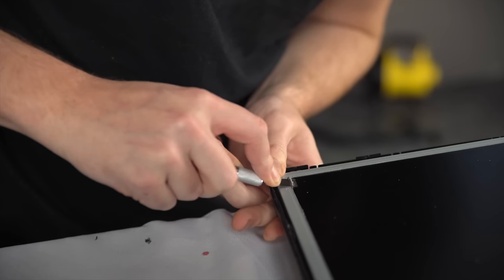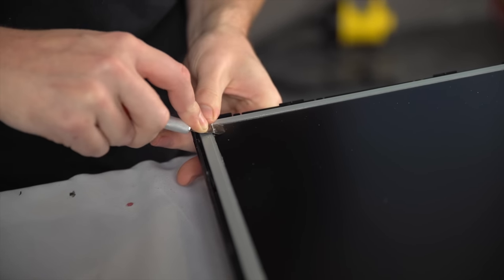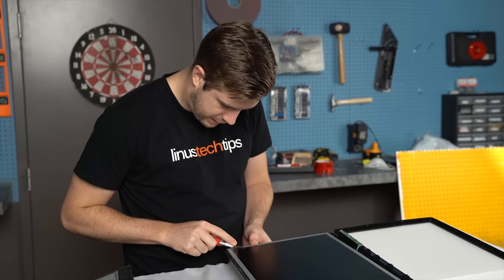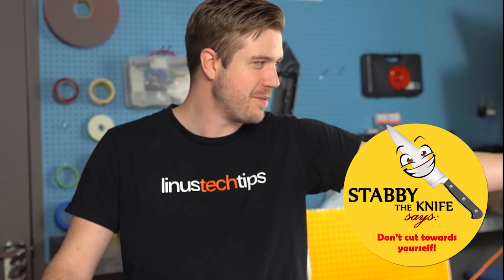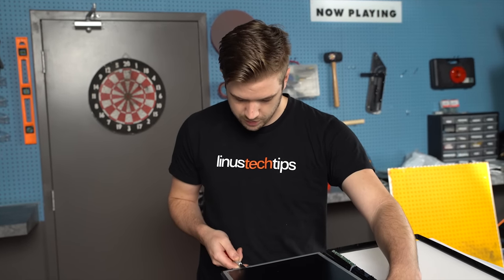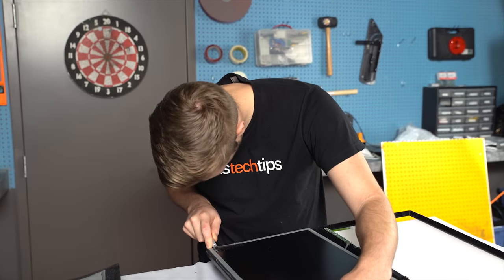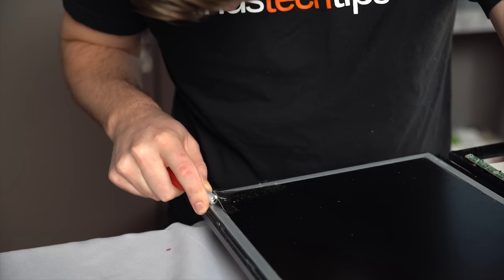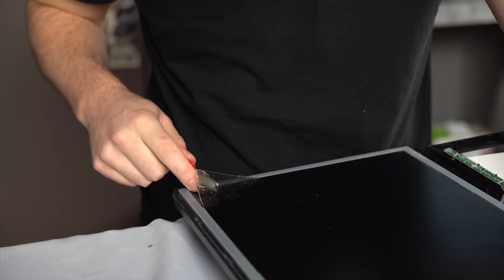Now what we need to do is try to get under those lines we cut and start actually pulling up the polarizing filter. There is glue under this entire thing, so while you can pull it up sometimes, you do really need to chisel under there and separate the polarizing filter from the actual panel. The reason you want a nice clean cut with a sharper knife around the perimeter is so that when you're moving along with the chisel, the perimeter actually comes up. I'm pushing in and then sliding out, angling a little bit, pushing in again and just moving along, and the perimeter should just come up with the knife — which keeps a clean edge. Once you start going, everything does get easier.